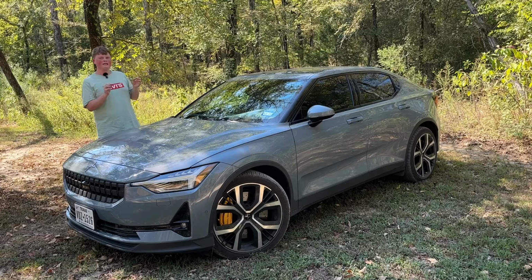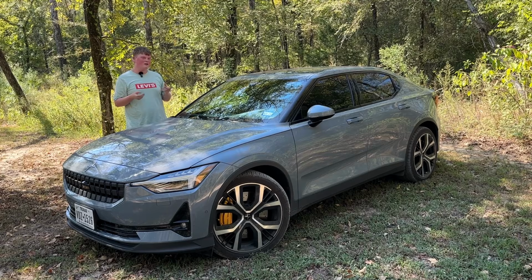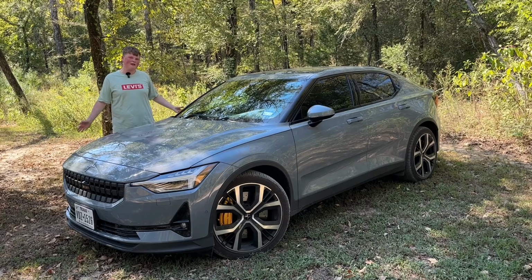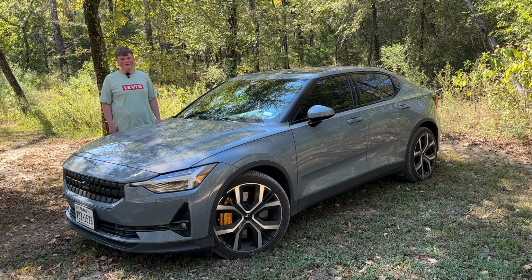What happened was a little itty bitty rock got stuck in between the disc brake shield and the actual brake disc. So whenever I backed up, it made a sound. Luckily, all I had to do was take the driver rear wheel off and I just wiggled the brake shield and a rock fell out and it was fixed. That was like the easiest fix of all time. So it's fixed now and it doesn't make any weird noises, so that's good.